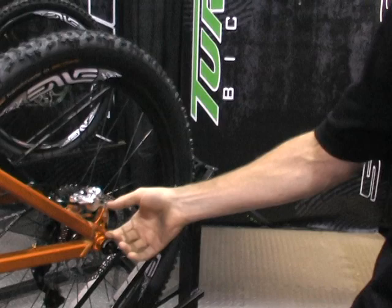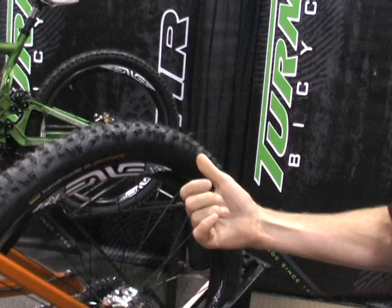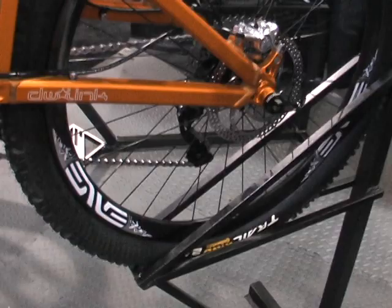So in addition to getting some lateral compression, you're actually getting some radial expansion, basically like a pinch bolt in reverse. So it does help the rear end. We use Envy wheels on a lot of our bikes. We're one of the larger OE customers, probably not the largest, but certainly big fans of the Envy stuff. It's a really stiff wheel.